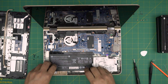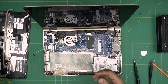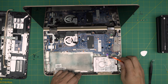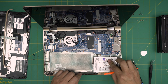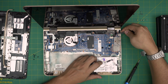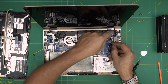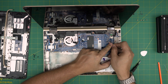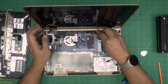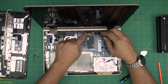Once the screws are removed, grab the battery from the back side, bring it up and slide it upward — there you go. Now disconnect the hard drive by lifting the jack upward and pulling the cable back. Next, disconnect the power jack cable — untangle it and bring it upward. I use tweezers on the side of the jack and push backward so I don't damage the cables. Then lift the black cover for the LCD flex cable jack up 90 degrees.